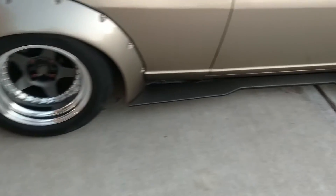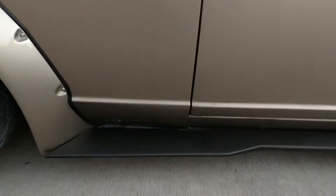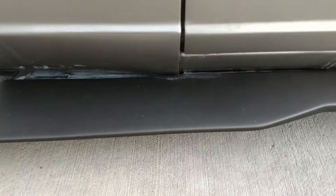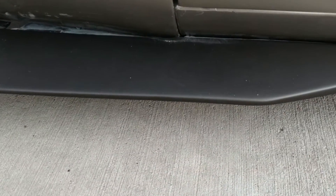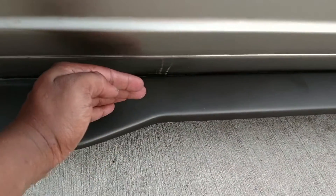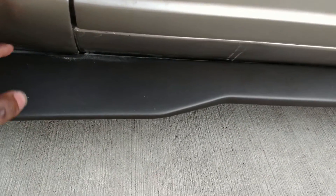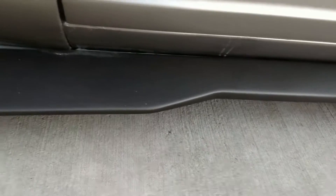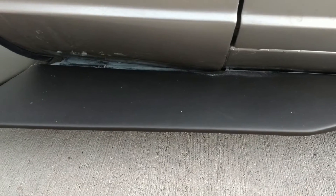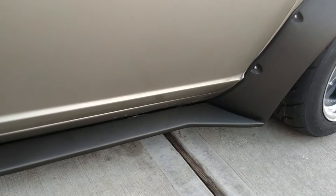Here was my issue down here — my fender. The rail underneath where you originally jacked the car up from, it's twisted out. Coming from here, it's twisted out gradually, more and more, so it pushes this out. So I couldn't get perfect alignment. After I painted I had to cut out a bunch more in order to get it on there and make it line up as much as I could. That's no reflection on the kit.